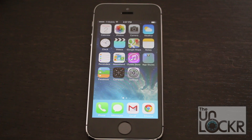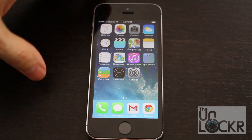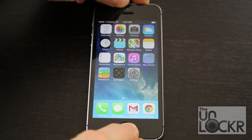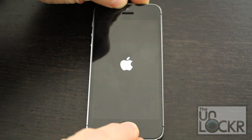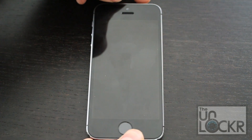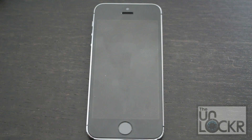Let's pretend that this iPhone is stuck, whether it's in a boot loop or stuck on a screen — it doesn't matter. We're gonna hold down home and power at the same time and keep holding them. This is our kind of emergency shut off. Wait till the Apple logo comes up and goes away again, then you can let go. Now the device is off.